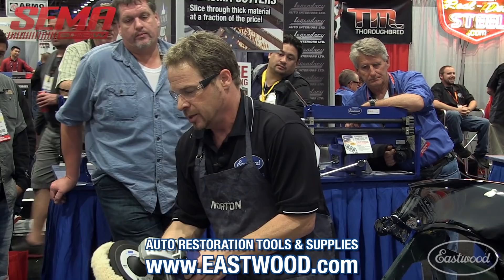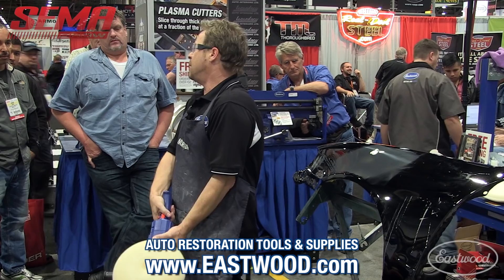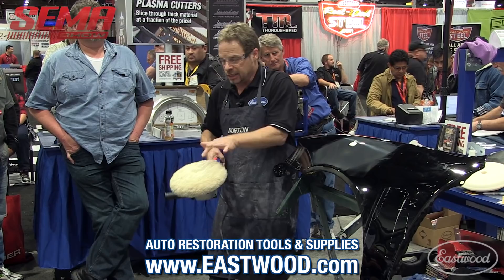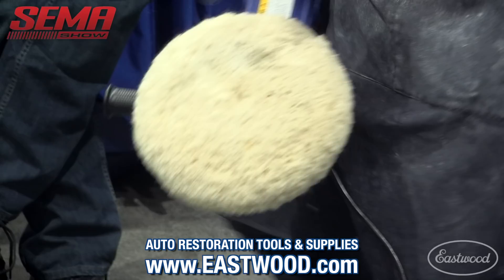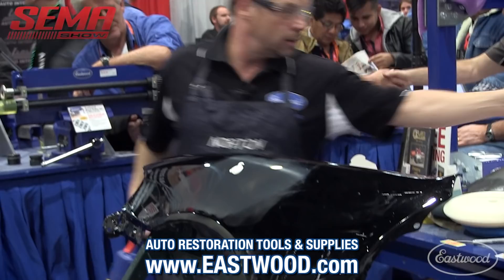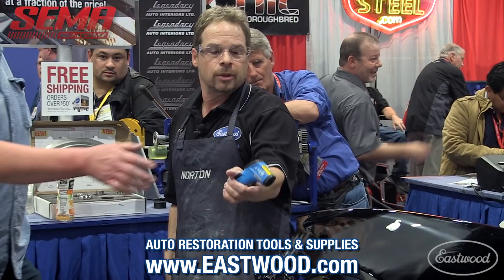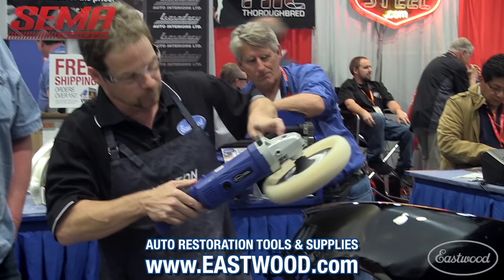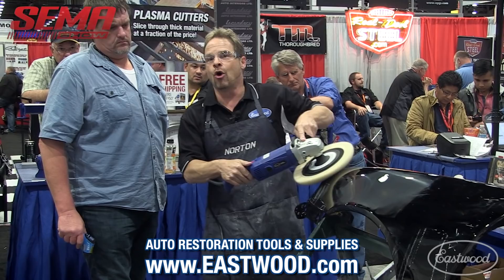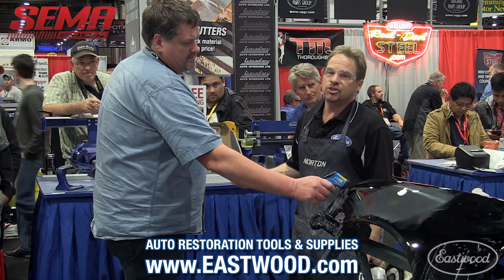I was a knucklehead and started talking to people yesterday without cleaning my pad out, so I'm going to spur it — knock the compound off the top. Let me use a point-and-shoot thermometer. Shoot that panel right about there. It says 69, 70 degrees right now. Let me buff for about five seconds — now it says 86. So we picked up more than 10 degrees in the count of five. My point is: keep your surface cool.